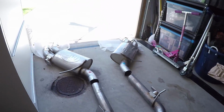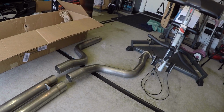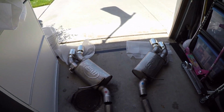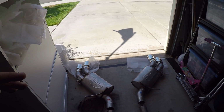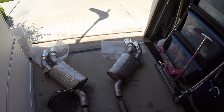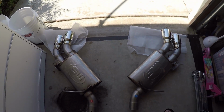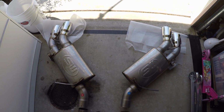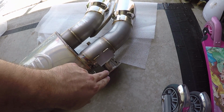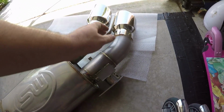So as you can see, I have the full exhaust laid out on my garage floor, how it would connect within the car. Now, most of you guys have been asking me, is this system NPP capable? And yes, so if your Camaro is the 2016 Camaro SS and you have the dual mode exhaust from GM, this keeps that functionality. You can see their valves that they have set up here, you basically take your actuators off the stock exhaust and you put them right on here.